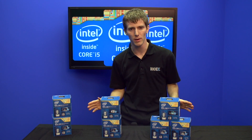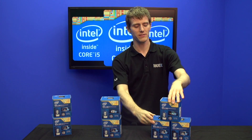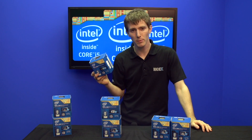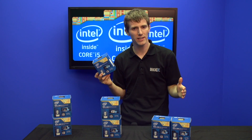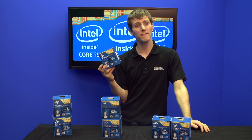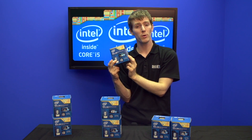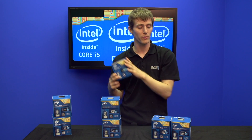So what do the suffixes mean? The regular 4770 is vanilla — clocked slightly slower than the 4770K, though all have Turbo Boost and all are i7s with Hyper-Threading. The K is your unlocked, overclockable CPU with an unlocked multiplier, so you can easily turn up the multiplier and voltage for a great overclocking experience. My sample does about 4.7 GHz on all four cores without difficulty, though your mileage may vary — it's luck of the draw. With the built-in VRM on the CPU, heat output can increase, so you may need a good liquid cooler to get the most out of overclocking.